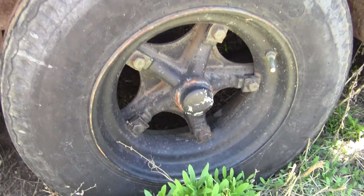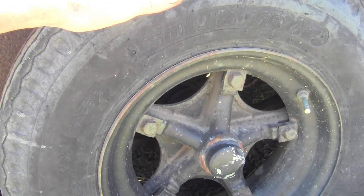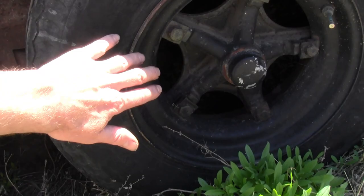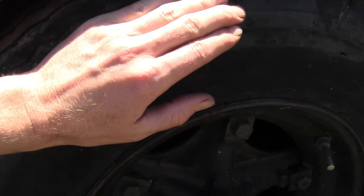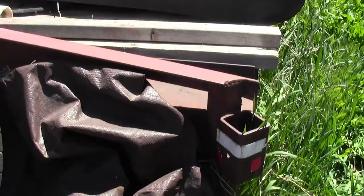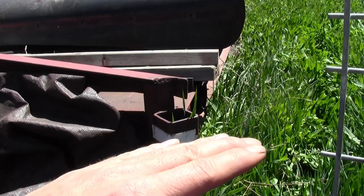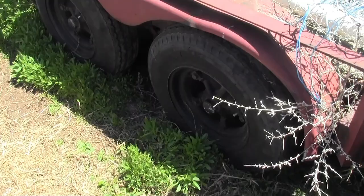I'll show you — this is a Dayton wheel. They're really common in trailer house applications. They're made to haul an extreme amount of weight with a very small tire. It's only a 14.5 inch rim. You can see here — my knee shows how small they are — but they're made to haul a lot of weight. There's a huge advantage with these on a car trailer because you can see how low you can get your deck height. Even with the axles everything, I can put a ramp on there and even if the car is real low, it's easy to get up onto this trailer.